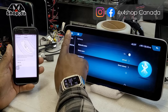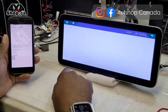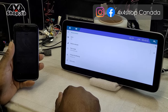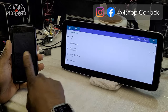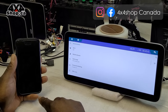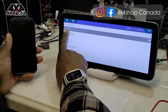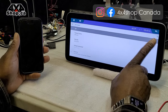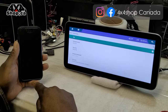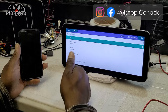One last thing on the Android device: go to home, then go to settings and go to your network settings. Apple CarPlay works with both Bluetooth and Wi-Fi hotspot from the Android system. If you are giving the unit hotspot from your cell phone, Apple CarPlay will not function properly because it can't receive and send a Wi-Fi signal simultaneously. On the Android system, go into the hotspot and make sure your hotspot is turned on. If the hotspot is not on, you will not be able to get the wireless CarPlay signal because it works through both Bluetooth and Wi-Fi.